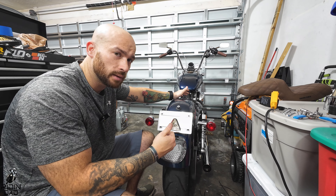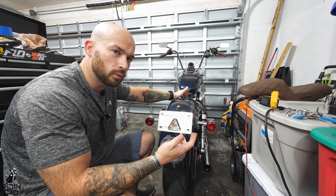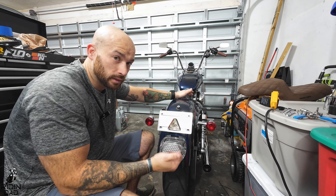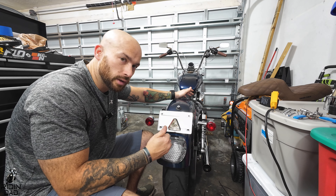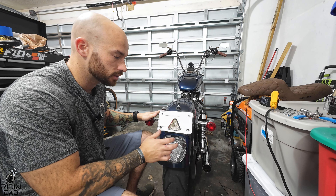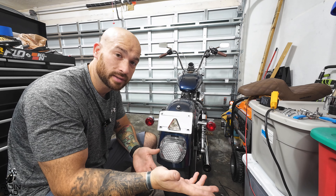It appears that it's just one wiring harness that fits directly in there, and then the turn signals plug in here — which means there's like a circuit board in that bezel where the wiring harness connects, and then your taillight plugs in. So it makes it super easy because you don't have to do anything else. There are those circuit boards in the bezels of other bikes too — the only difference would have been I'd have to order another harness. That harness has everything and replaces the turn signal lines, running everything just like this bike does from stock configuration. This literally is 100% plug and play — even videoing it took like six minutes.